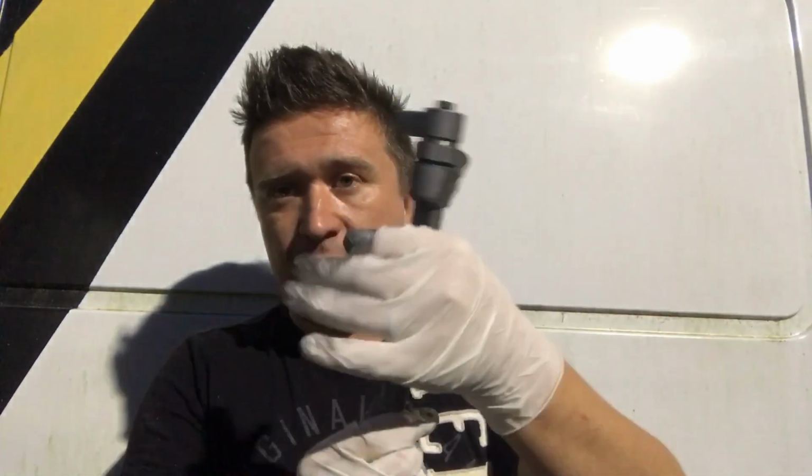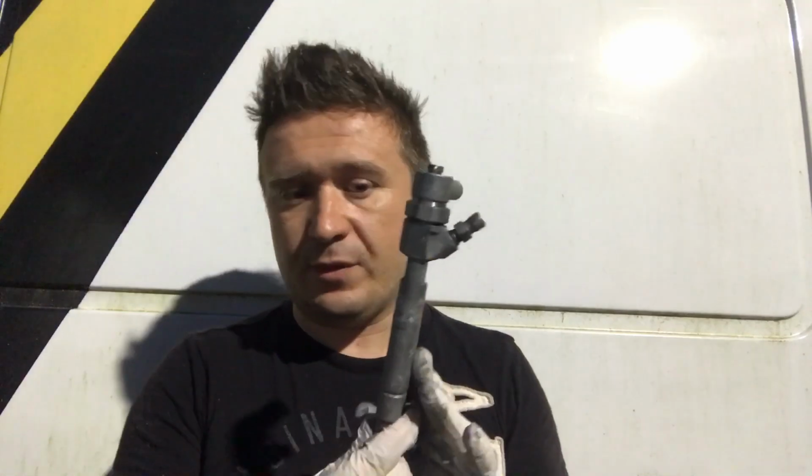The Mercedes technician I was speaking to says that they don't oxidize, but actually they do, because the fuel injector is made out of steel and the head is aluminum. It's just the science of things: once you have aluminum in contact with steel, oxidation will happen. These two metals cannot be that close to each other. This is why Sprinters have a problem with injectors being stuck and glow plugs being stuck. If you apply some high temperature grease from Mercedes, that ought to work, but anti-seize lubricant works fine for me.